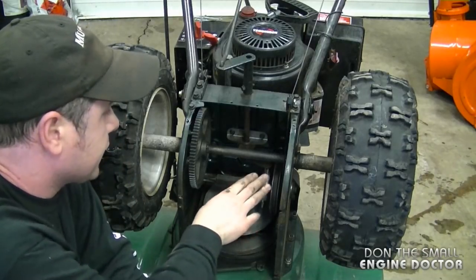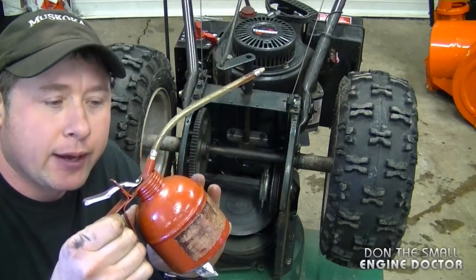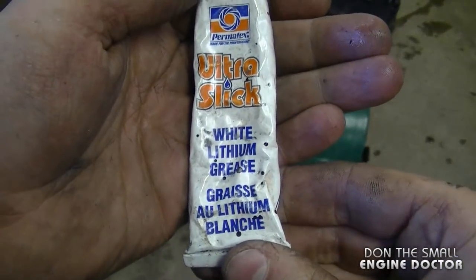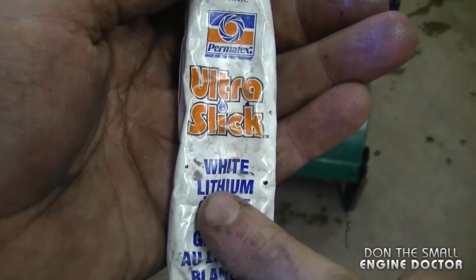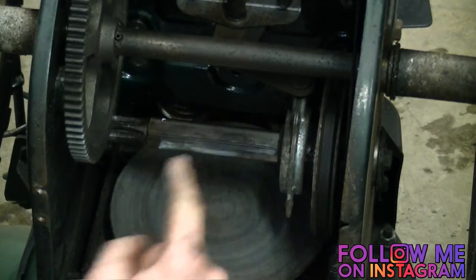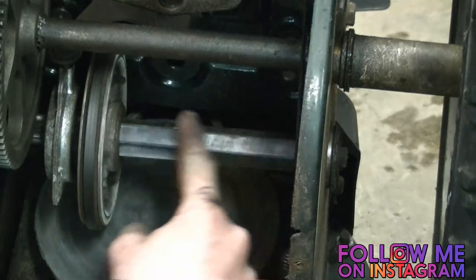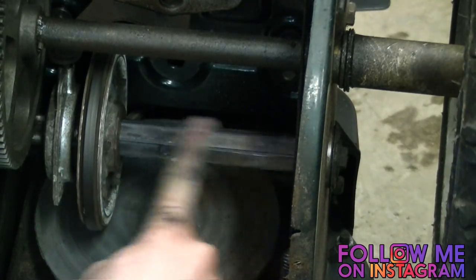What I like to use to grease up the shaft that the drive disc slides on is lithium grease — that's my number one choice. My second choice is to use my oil can; I have transmission oil mixed in with motor oil in here, and I do have a video showing me mixing that oil. The link is in the description. The lithium grease comes in a small tube and will be more expensive than using oil, however this grease will stay nice and soft during the winter. I put a nice thin film all around the shaft, turning the wheel to turn the shaft so I get every surface. Then I move the shifter to the opposite direction to clear the shaft and finish up the other side — just move the wheels so you can get all surfaces of this shaft. You don't need much grease.